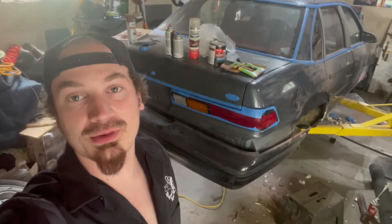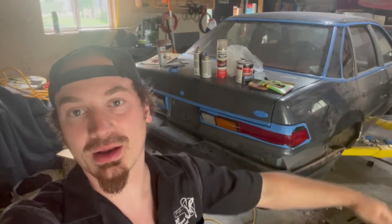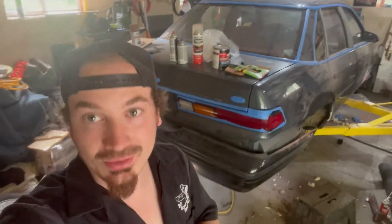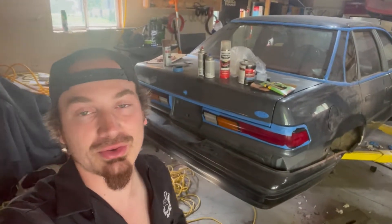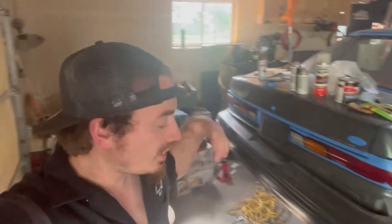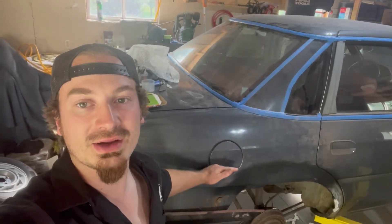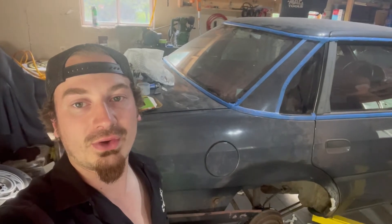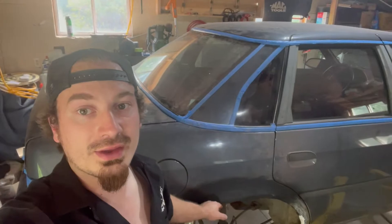Skipping ahead a few days — we're back with the Ford Tempo project. As you can see, I got all of the main areas taped off and I just need to fill it back with paper because we're going to rattle-can this entire car with some Rust-Oleum 2X paint, trying to get a color as close to this as possible so I don't have to do the door jams. One other thing: this car was really super rusty in the wheel wells. You can see right back here we got this one all filled in — essentially where the black was there was a complete rust hole.